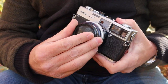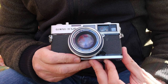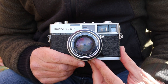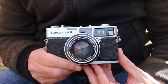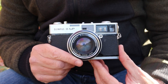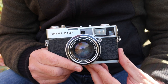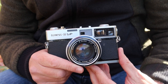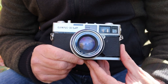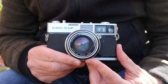On the front are the important operating parts of the camera. In the middle is the G Zuiko 42mm f1.7 lens. The G Zuiko designation means it has seven elements, and it's quite an excellent performer. Provided it's clean and in good condition, it will give you really amazing photographs — arguably more precision than you can get from SLR cameras. Rangefinder cameras don't have the retrofocus system that SLR cameras require, which allows the lens to sit closer to the film, improving resolution. It's really an excellent lens and one of the great features of this camera.